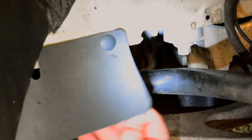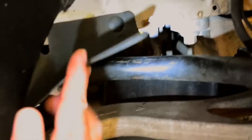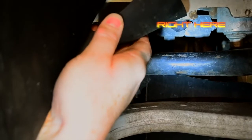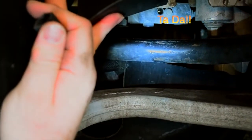Right here in the front of that is a little, very pliable flap. If you raise that up, you'll be able to see the black cap right there on your air conditioning low pressure side. Reach up in there, unscrew the cap, and you have access.